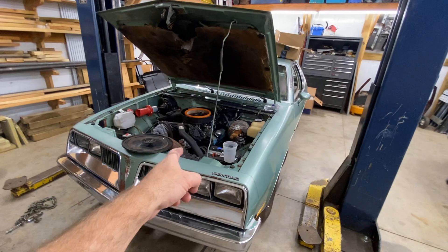I'm under the car — it is gorgeous under here. Rust free, fucking mint. She's solid as a rock. We got the exhaust disconnected. I've got to disconnect this exhaust hanger which is bolted to the transmission tail shaft. Then we've got to take all the transmission stuff off. It looks like there's some kind of spacer in there that shouldn't be there — that's what the torque arm is bolted to, which we obviously have to disconnect. Making progress.